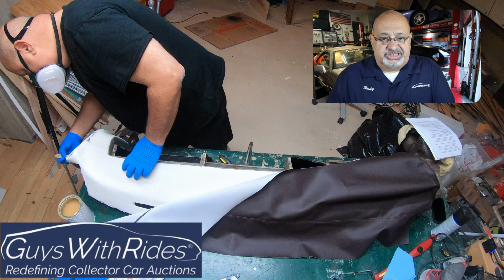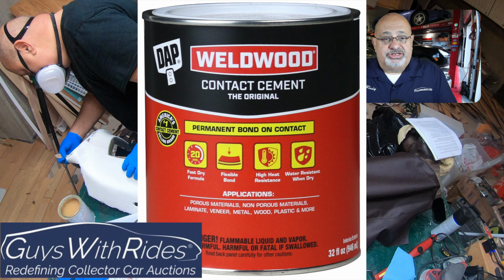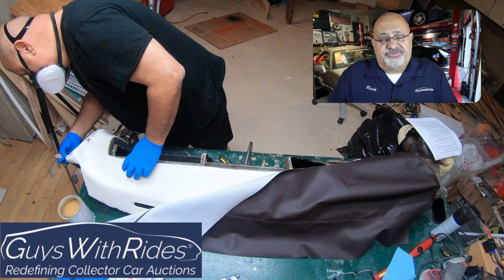All right, before I even get started, quick safety note. Take a look at what I'm wearing. That is an open can, and I'm in my messy shop area. First thing you've got to do is you better have a paint respirator on. That is an open can of rubber cement or contact cement. I would use it in a well-vented area. It is flammable, but you see me wearing the respirator. If you don't have that on, you're going to have a headache within 20 minutes.